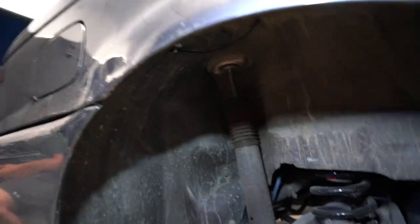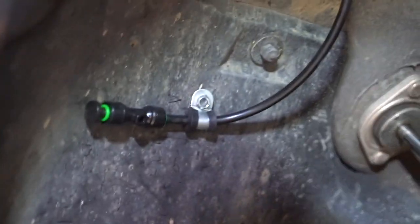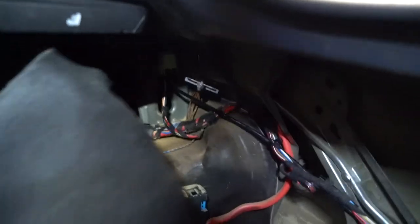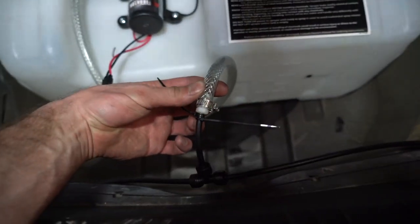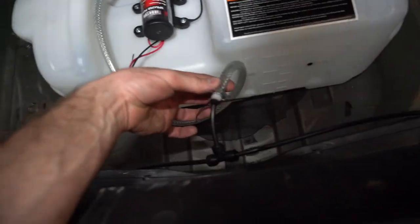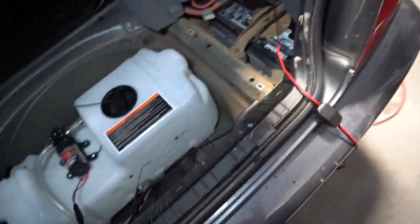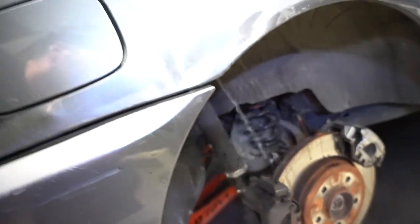We just got all the plumbing wrapped up — let me show you how it came out. Underneath with my headlamp on, she's nice and P-clamped up — a self-tapper on the P-clamp and my little mist nozzle with the green fitting going right into the car. I tucked the hose behind the carpet, zip-tied it along the wire loom, and tucked it up underneath the trim. There's a T-fitting which adapts into the clear hose — I had to buy another fitting for that. Same thing on the other side; it sits up a bit further but still shoots at the middle of the tire. With the plumbing done, it's time to move on to wiring.